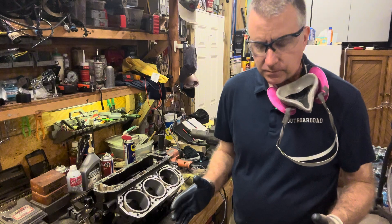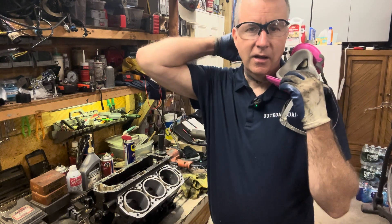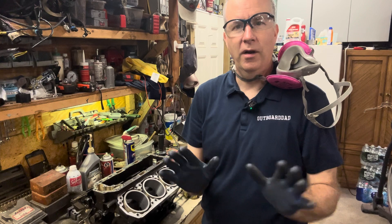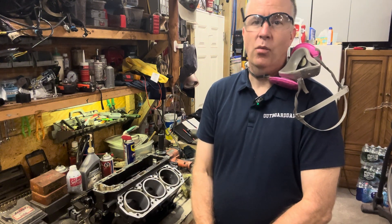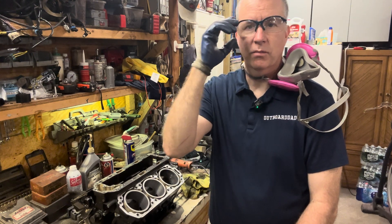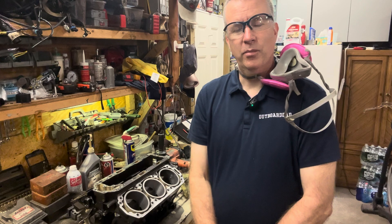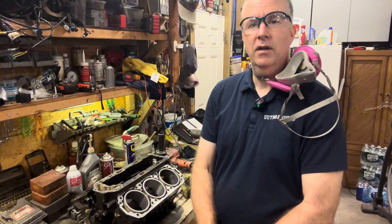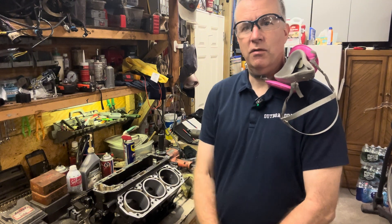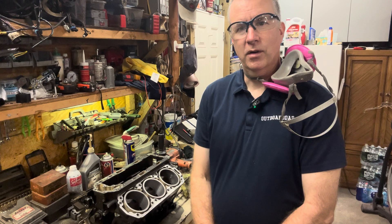Keep in mind, this does take a lot of time as you can see. Make sure this is something you want to do — number one. Number two, nine times out of ten it's just one or two cylinders that you have to do. This one just happens to be six because of the warping and being out of round. Sometimes you go to the machine shop and they'll tell you, listen, you can't just do one. This block was really bad and you don't know if they're telling you the truth or not. The only way to know for sure is to take it apart and measure it yourself. So we're going to continue on boring this out. I'm going to get some straighter stones in there now in these two cylinders and get this one cleaned up — it doesn't have as many scratches. Take some material off and then we'll continue on with boring.